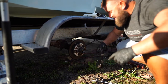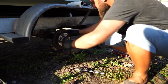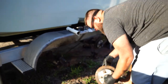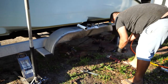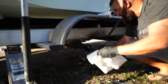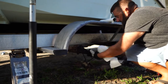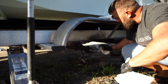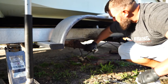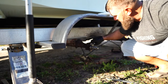Much easier than I thought. As you can see, I had to grind the heads of these bolts off to get this old caliper off. At this point the hubs will come right off. These are trash. Now is a good time to get all this old grease cleaned off and check to make sure you don't have any crazy marks in your axle. This one looks pretty good — looks like it should seal just fine with a new hub. I probably got another year on this spindle before I'll be replacing it.